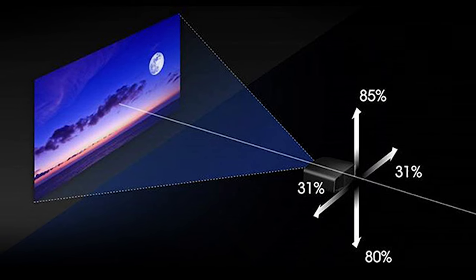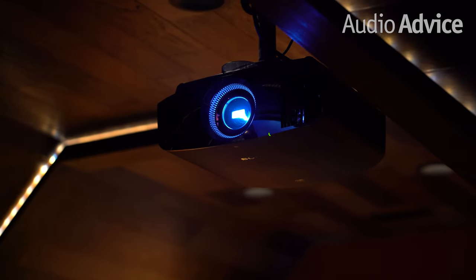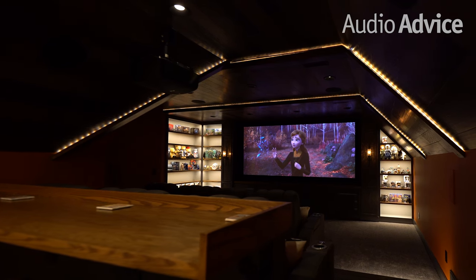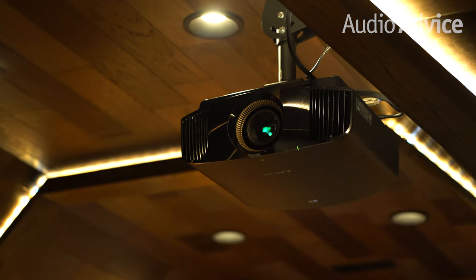One of the best features of the VW325 is its installation flexibility. Lens shift allows you to move the image up and down or left and right on your screen with zero picture degradation. This is incredibly important if you do not hang your projector perfectly centered on your screen — you can actually be off several inches and still perfectly fill your screen using lens shift. For the DIY person, lens shift is a massive bonus. We actually have an installation video on our website where the projector was in an attic and we had to offset it dramatically because of the shape of the room.